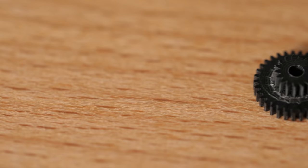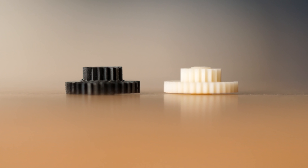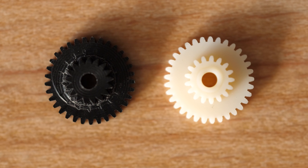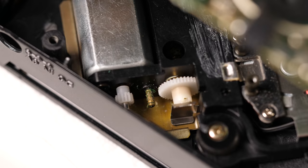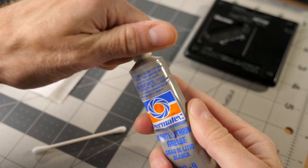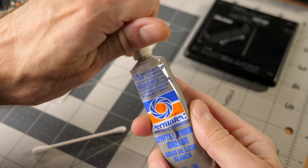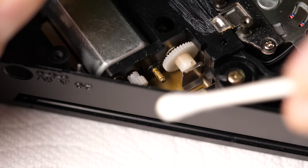Comparing them, the gears I bought from Taobao actually looked to be quite well made — their dimensions were a match for the original and the plastic molding appeared to be high quality. I suspect they would have worked fine, but since I paid so much for the NOS gear, I decided to use it instead. The post was covered in the remains of the old grease, and I cleaned it off with a cotton swab soaked in isopropyl alcohol. I then applied some white lithium grease, which I've had good luck with on things like floppy drive mechanisms — just a small dab was all that was necessary.